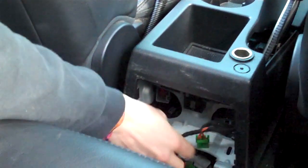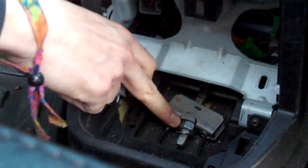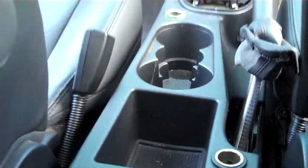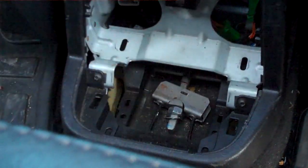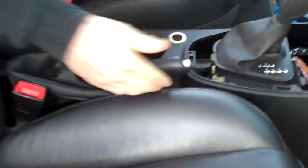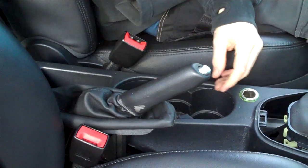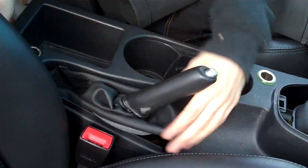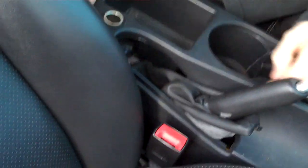You may need to release the handbrake tension so you can lift the handbrake higher. We've marked where it was and unwound it — you need a 17mm hex and an open-ended spanner to wind it back. The problem is normally the handbrake only lifts to about here, but you need to get it right up to clear the console. The console is two-piece so it should go down through the slot.